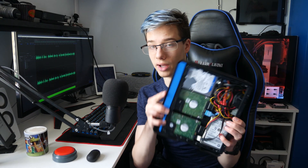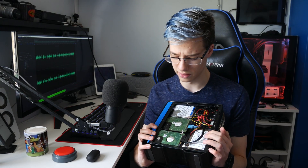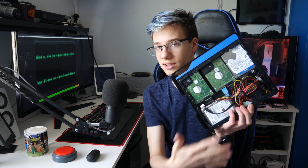I'm going to show you the back now, because the second I heard the drive was failing I powered this entire thing off, took it down, and unplugged all the other drives that weren't failing, because we are going to attempt to clone this drive here which is the one that's failing. Please remember that you don't actually need a secondary hard drive to back up your data — Clonezilla also allows you to back up your data into an image. It's my only non-Western Digital drive in this array. This is an HGST drive. It's a one terabyte drive and they're all nicely packed in the back here.